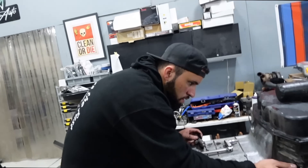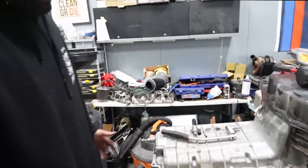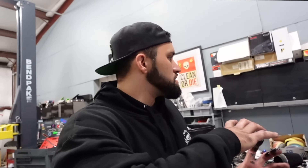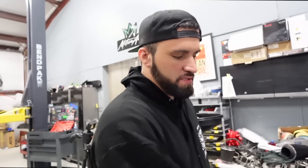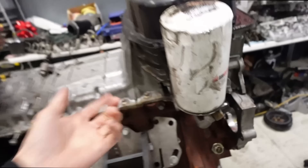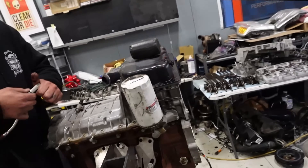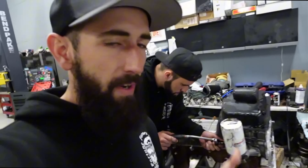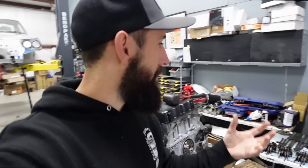As for the turbo, both up pipes fit perfectly on the 2017 turbo. The only difference on the turbo is the cartridge housing where the oil feed line is placed — it's positioned differently, but we'll just use the 2017 feed line. We got that sorted out. The oil pump, I'll show you guys in the front — it's essentially in the oil pan, whereas previously on a 2017, it was kind of in the front cover, like a standard helical gear setup.